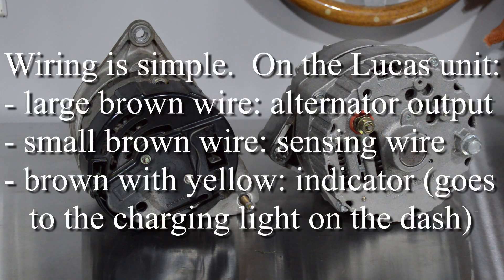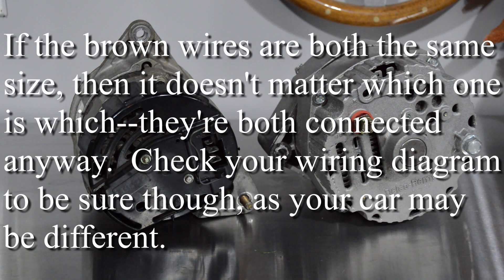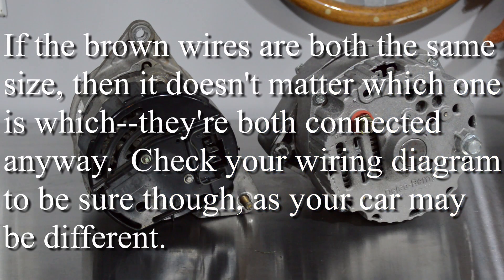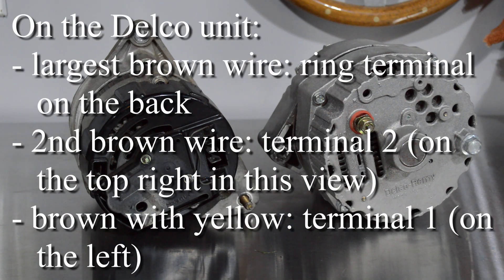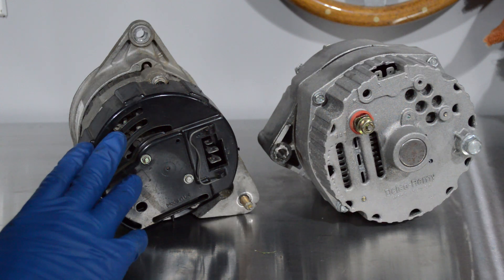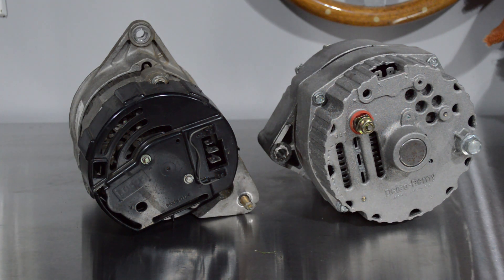So you don't really have to worry too much about the unit itself. And sometimes you can even find them with instructions on how to change that — you can undo these bolts, rotate the housing, put it back on, and it will be just fine. So let's put the Delco alternator in the car. If we've got time in this video, I'll show you how to fix this one. If not, I'm going to make another video discussing alternators more thoroughly. Subscribe to the channel if you haven't and you'll see that as it comes up.